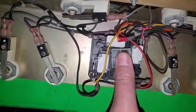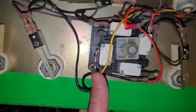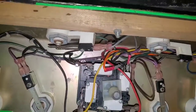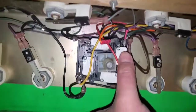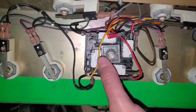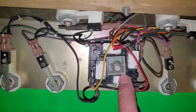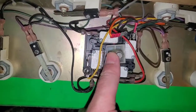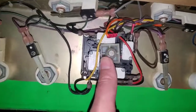So if you've got a character that's not moving or stuck in one direction, just check these wires. If it's stuck going right, check this one right here. If it's stuck going left, check this one right here. Just use common sense with whichever direction it is. If you have to replace the whole joystick, they're standard arcade joysticks. I'll put a link below where you can get a replacement joystick for virtually 99% of all the 80s games.